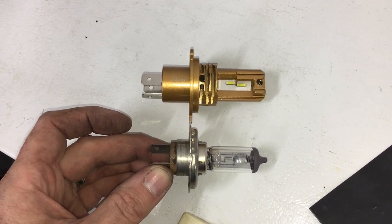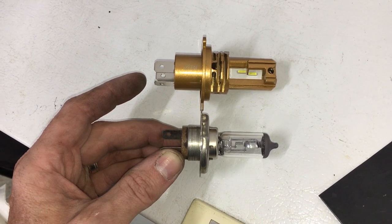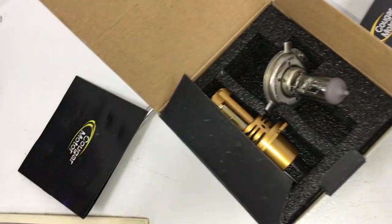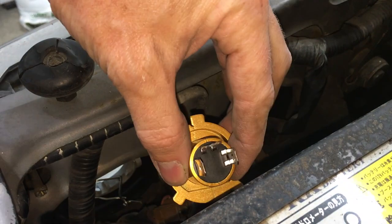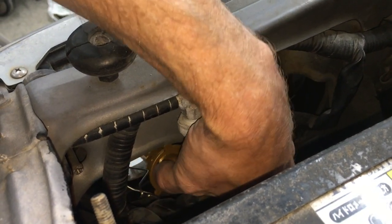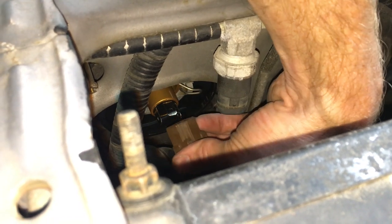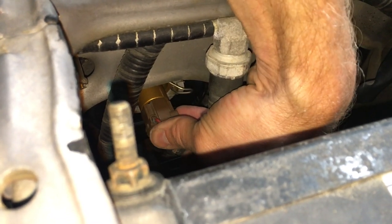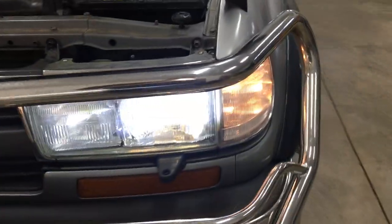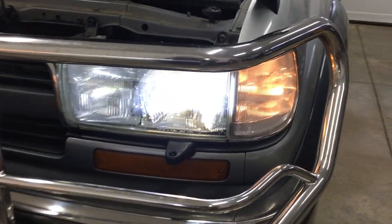Here's the new versus the old. You can see the LED bulb is a little longer on the back, but that shouldn't be a problem. I'll save the old bulb just in case. Then it goes back in the housing in this orientation — it only fits in properly one way. If you have huge hands, good luck. Then lock the clip back on. Before I put the rubber cover back on, I'm going to make sure everything works. Here's halogen and LED — this really updates the look of the vehicle. Looks like the lights might be from this century now.